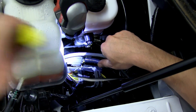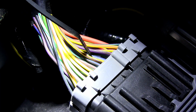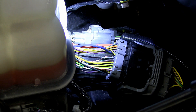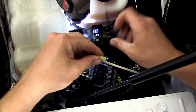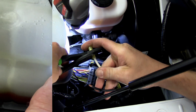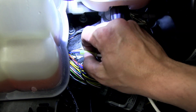Next I'll go ahead and remove the manufacturer's connector from the wheel well here. We'll take our utility knife and cut back some of the electrical tape so that we can pinpoint and access the dark blue wire that runs into the connector. If you look closely, you'll see the dark blue wire runs into the connector but does not come out of the connector. This is the manufacturer's brake signal circuit. We'll go ahead and cut it, strip it back, adding a butt connector to the white wire that we just ran from the 7-pole. The other end will connect to the dark blue wire we just cut going into the connector. Note that we'll be cutting the opposite side that runs into the connector here on the fender well. This will complete the brake signal circuit back to the 7-pole.